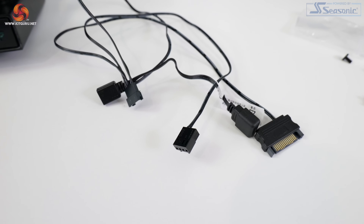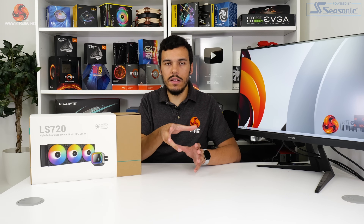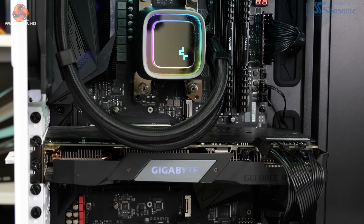The final step is to connect up the cables, where Deepcool supplies breakout adapters that link SATA power, 4-pin PWM control, 3-pin ARGB, and the proprietary fan connections. It wasn't that bad overall — there were a few more steps than usual, but the process was just a little bit more fiddly than the hand-tightening brackets and standard fan connections of competing coolers. On our AMD platform, we installed with the tubes sitting near the RAM slots. Deepcool does highlight that on Intel platforms, you're better off with the tubes in the 6 o'clock position — towards the bottom near the PCIe slot — as their internal testing shows better cooling performance versus the 3 o'clock position.